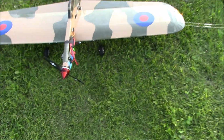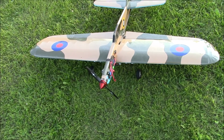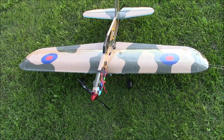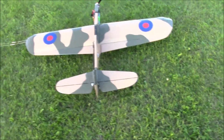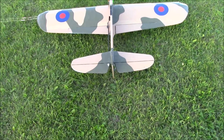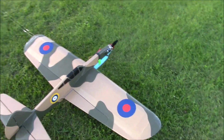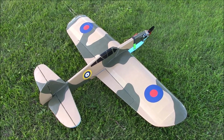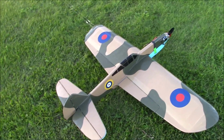Yep. 2,700 milliamp batteries, plenty. Lasted pretty good. I'm doing 5.3 second laps, and I got the RPM down to about 9,100 ish. So I could probably take a little more off it. Kind of stunned at that Master Airscrew though. I mean, how well it works. It picked up the lap time, something amazing.